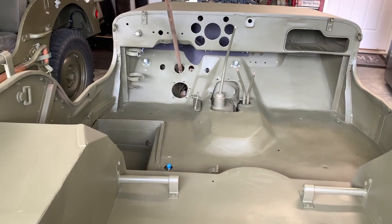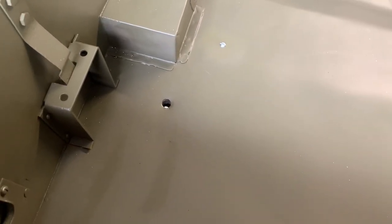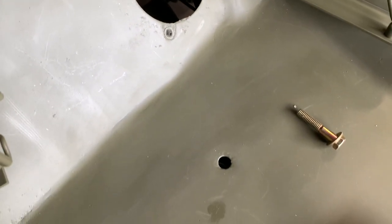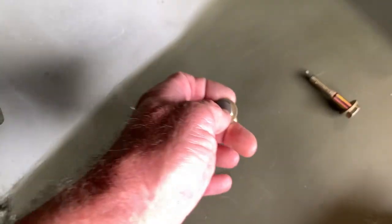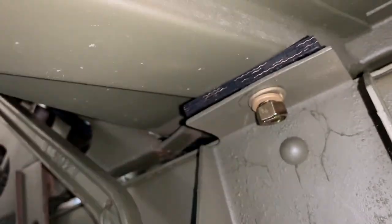Let's take a look at the inside of the body tub here, and you can see all the different locations where the bolts go. I'm going to show you them individually. One of the things you can do after you install the tub and to line it up is just look down those holes or use some sort of a punch to line them all up and make sure you can look through and see through with no obstruction. The first bolt that I'm going to install is the front of the floorboard there by the gas pedal, and that bolt size is 3/8-16 by 1-3/4 inch. I'm installing a flat washer on the bolt before I install it into the tub. The second hole is right across on the passenger side, and that's the same size bolt.